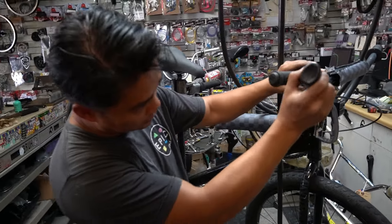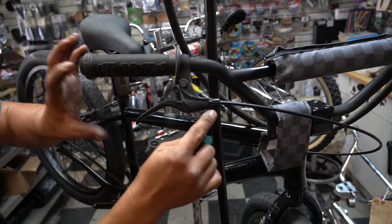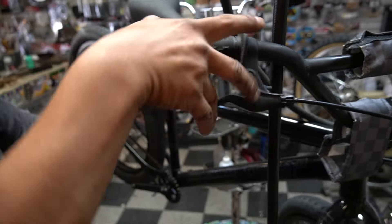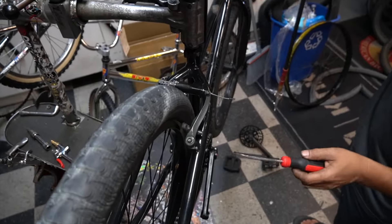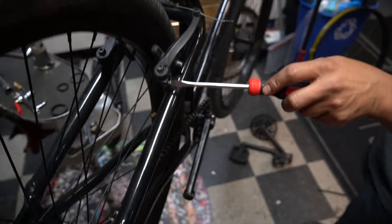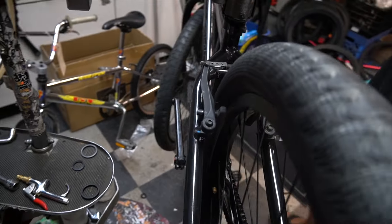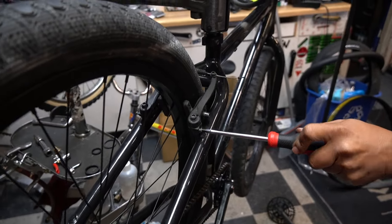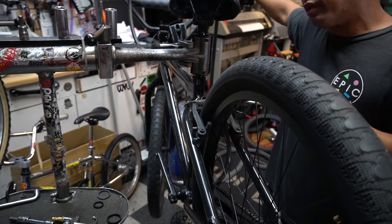Whenever I do a brake tune-up, this is one of the key places - right in there, top and bottom. Now it doesn't move. Look at this - this is the tension, this is how you adjust the tension. Each side has one adjuster - one right here, one right here. Watch, I'm going to loosen the tension. That's all I did - look at the other side starting to move. See how both of them are moving now. Earlier it wasn't, and all I did was barely touch this.